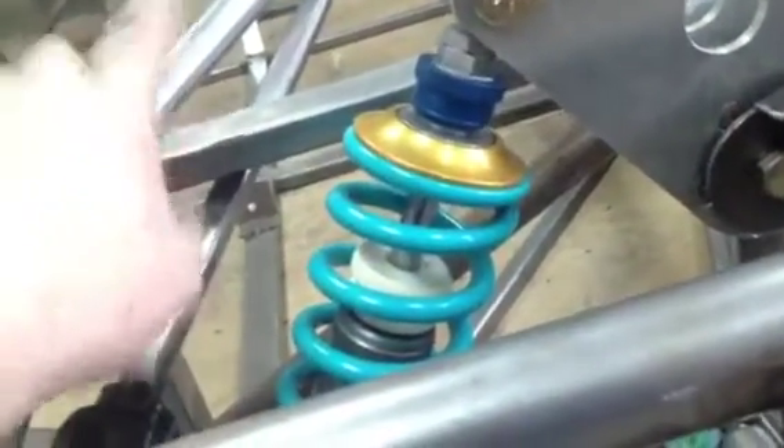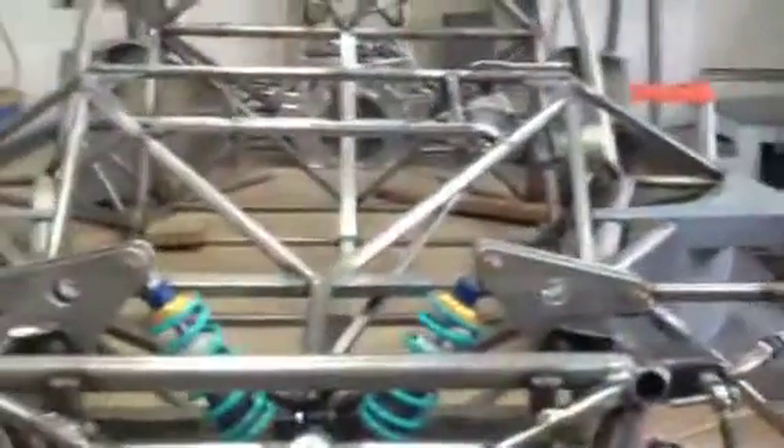This point here is also an inch further up than normal because we've sectioned the chassis and lifted the whole thing up an inch. So we have a lot more room, and as you can imagine looking that way, the steering column doesn't get close to your right foot. In a normal GTR, between the clutch and brake, if you have long tall feet — closer to size 12s — your foot would occasionally flick the steering column. Having this extra clearance for the steering column is nice if you're a tall person.